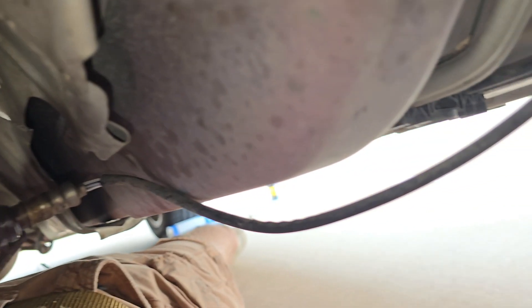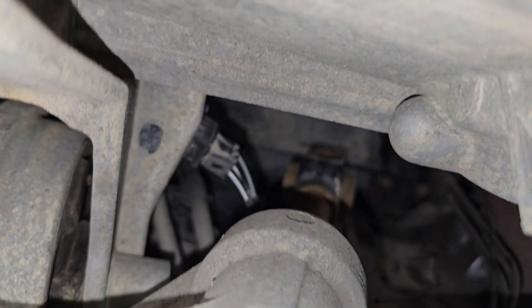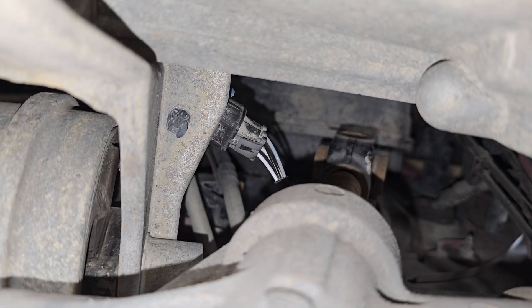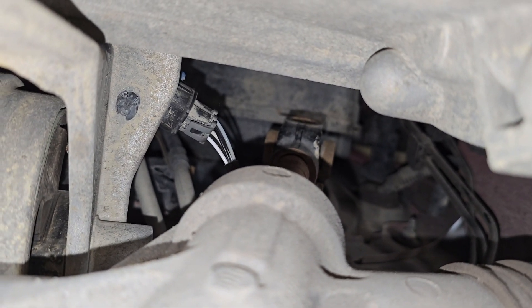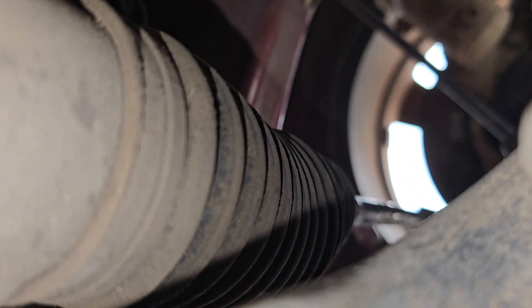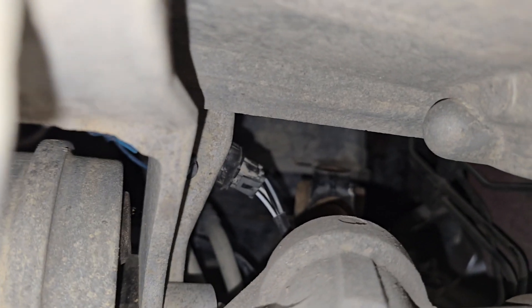Right here is the O2 sensor. We're going to follow the connection so that we can remove the connector first. If we come up here, right here we have our tie rod connection to our power steering, and if we go up just a tad, this is where the wiring will lead — this is your O2 sensor connection. As you can see there's not a whole lot of room whatsoever. So there is a small area right here next to the tie rods. Back down near the driver's side, stick your arm up through there and snake your way through to reach the O2 sensor.